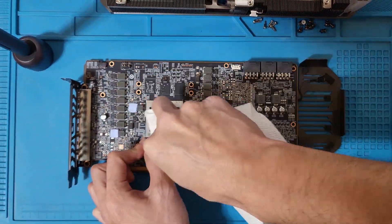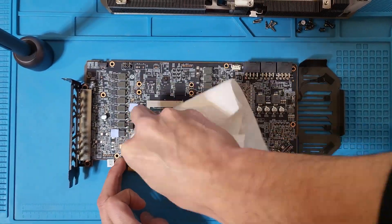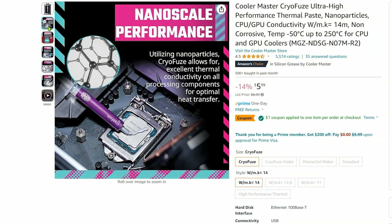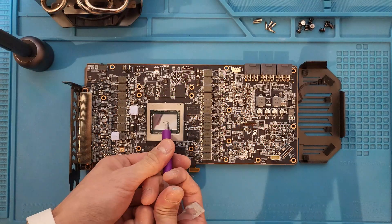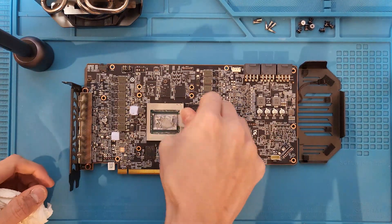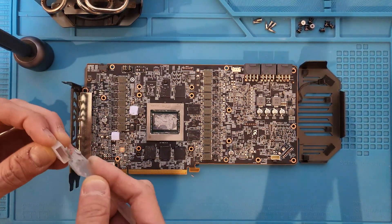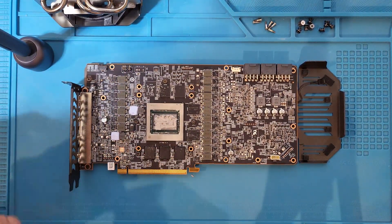Given this new information, I'm pretty sure if I put it back together with the proper pressure applied it would be fine. However, since I've got it open, I took the opportunity to replace the thermal paste with one of my go-to's: Cooler Master Cryo Fuse Ultra High Performance, which has a thermal conductivity rating of 14 watts per meter kelvin. The material is a bit viscous and thick compared to other pastes, but it works really well and has a much higher rating than anything else I've seen in this price range.